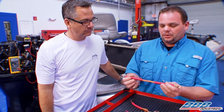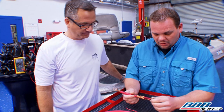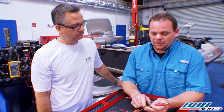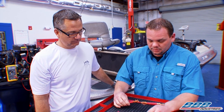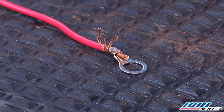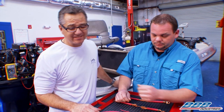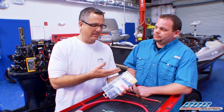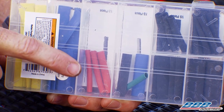I've got some cables here to show resistance issues. This is a perfect cable — nothing wrong, no resistance issues. But here we've spliced it apart for you so you can see. If the insulation were running all the way across, you wouldn't see the problem, but you can get big resistance problems inside the wire — it could be arcing inside, causing major issues. This corroded connection here is definitely what you don't want — it's going to cause high resistance, starting problems, and electrical problems. It's also damaging the starter because it's not getting the voltage it needs. When dealing with a boat, use shrink wrap connectors and dielectric grease on any connections. For any bolts, use anti-seize — anything to prevent salt water intrusion. Cables like this won't cut it on a boat; salt water wicks up the wire. Get nicely pressed cables so you don't have any exposed wire issues, and your starter will be like new.